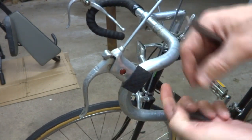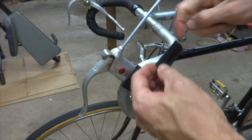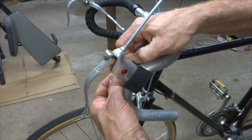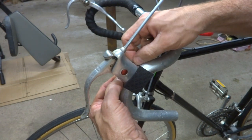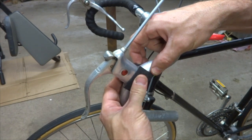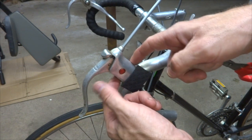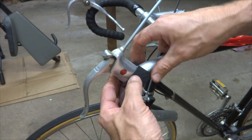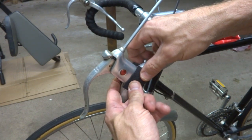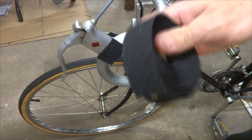I'm going to push that down and stick it there. With the second part, that's going to go to the inside the same way — put it back here like this. You want to make sure that it's not going to impede the brake lever at all. I want it to extend beyond the top and bottom of the brake lever body. Check the brake lever to make sure it's not going to impede it, and if it does, you can trim that part so it's not going to interfere.